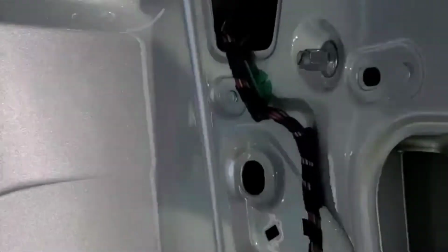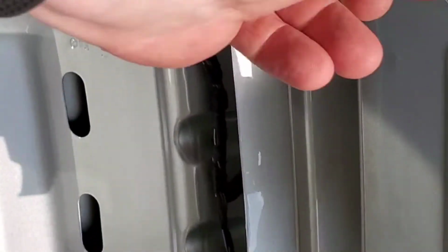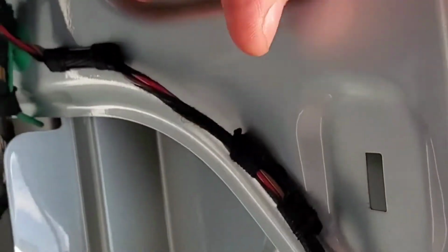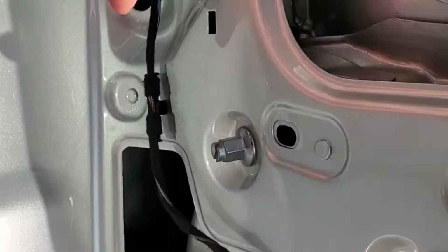Okay, so what I'm going to do is get started on doing that. We'll disconnect the lights. We'll pull out all these little brackets, these little connections. You should be able to get in here and squeeze from behind, and with the needle nose, squeeze and push it through the hole so we don't break those clips. So let me get started on that, and we'll take it from there.